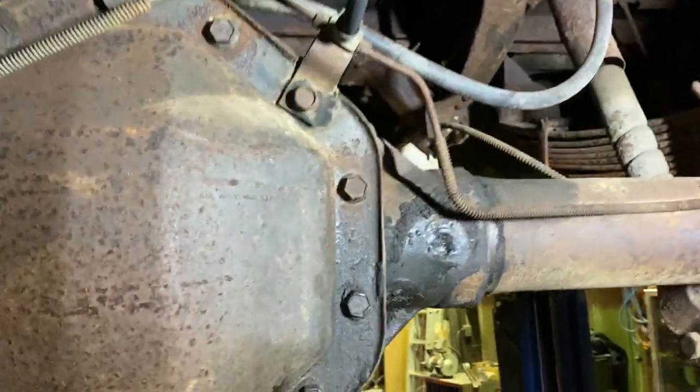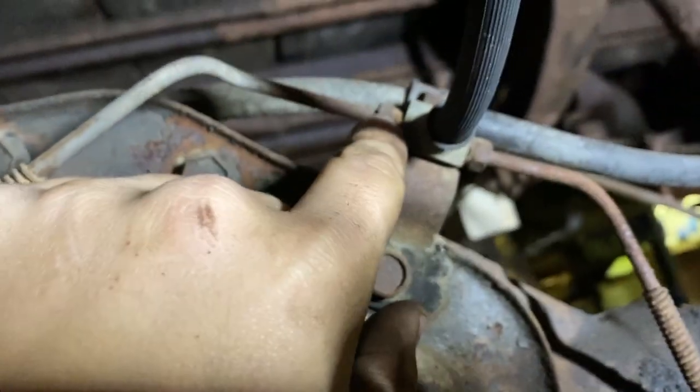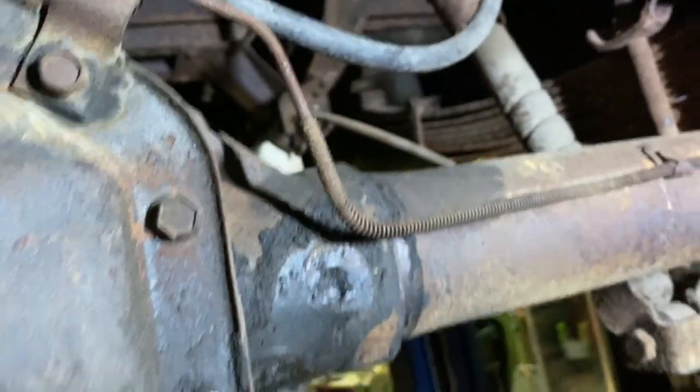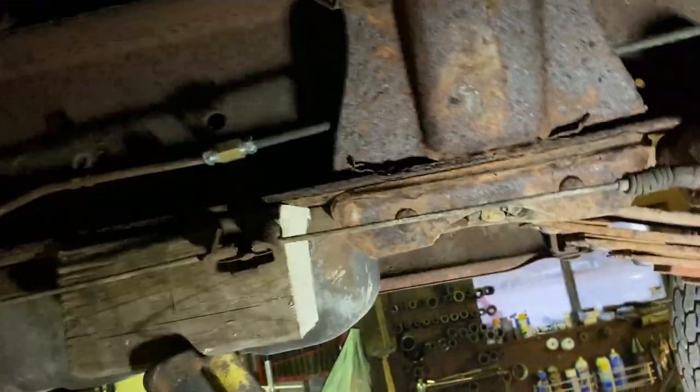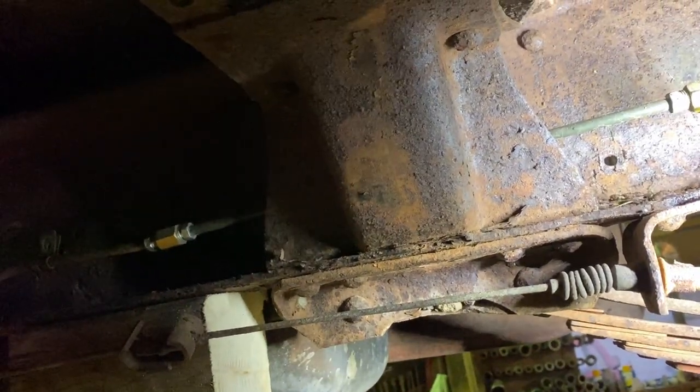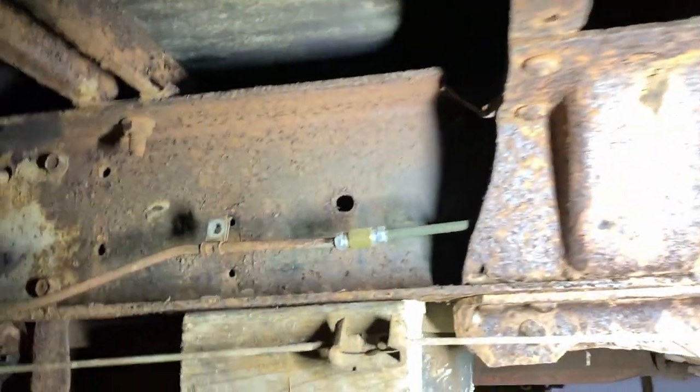All right, so back here, we have a wheel cylinder bleeder broke off and a really rusty one on this side. So the goal is to be able to crack the lines loose here and here and bleed it. Why? They repaired the brakes right here. That being said, I noticed there's a little bit of brake fluid there, so that might be why it's leaking.